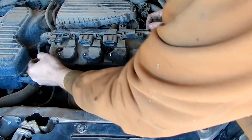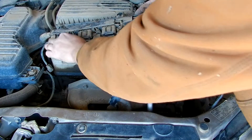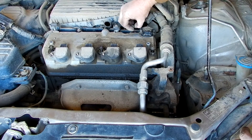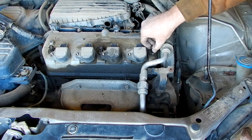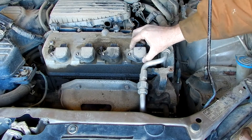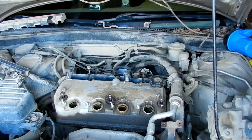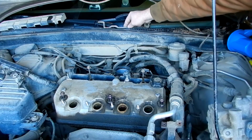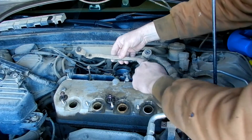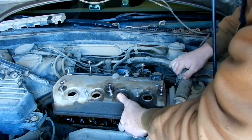There's also a little connector on this end that you might want to grab and pop loose, and just set it off to the side. I've loosened all of the valve cover bolts and I've also loosened all of the high voltage units and I pried this hose off the back with a couple of screwdrivers. I've decided to remove the air cleaner because on the back side of the valve cover is a metal bracket down in there, and it just has two little screws holding it in.